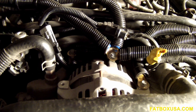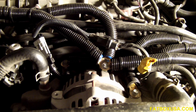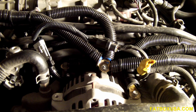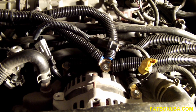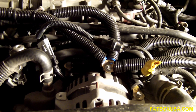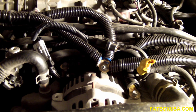So what I'll do is start the truck up and show you guys if the voltage increases. The old voltage was 14.4 volts when it's warm and 15 volts cold. So we'll see if we get more than 14.4 volts when the motor is warm with the V-Boost module, and I'll show you guys the results.